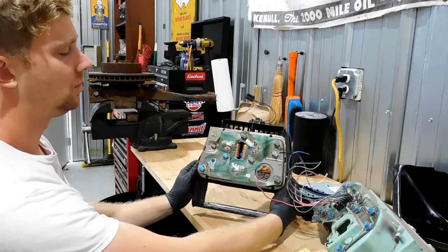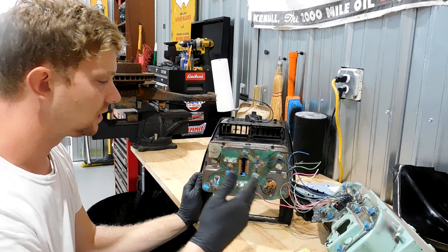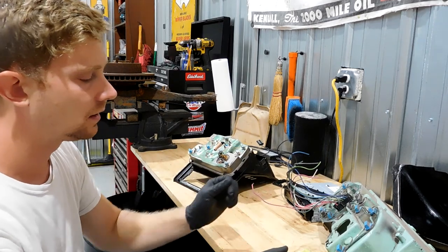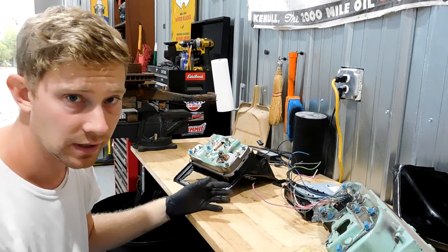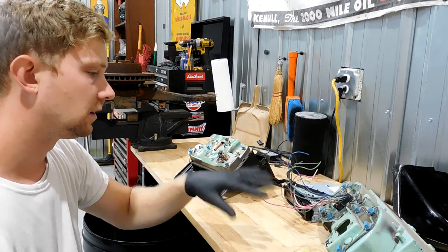In the past it had been a single plug for every single one of these things, and then it's just one master plug — plug it in and basically you're done. In the past you had to reach up and pull out one plug, put the new bulb in, put the plug back. It's easier to pull the whole entire dash out, but at least this way you can actually do it with the stuff still in the car.